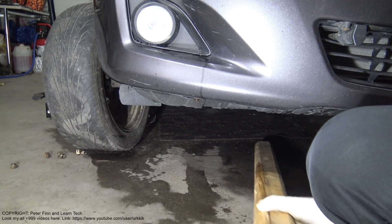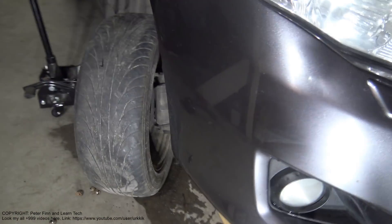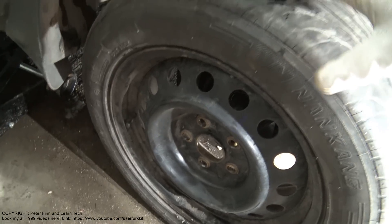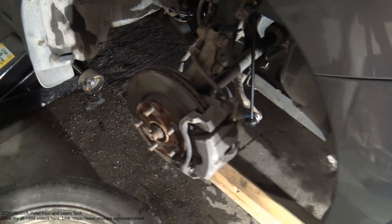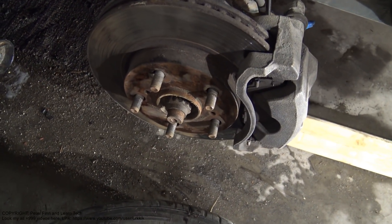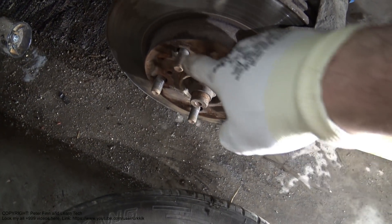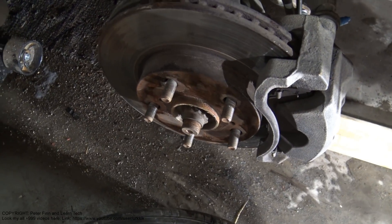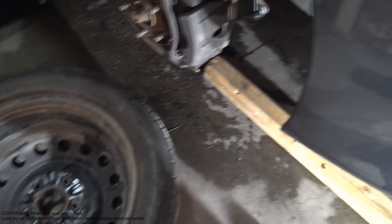Yes! Excellent — now this wheel is free. There was really a lot of corrosion there. And this is the idea — I managed to take that rusty wheel off. In that area we had so much corrosion and rust. If we insert some lubricant grease or copper paste in these areas, then we can eliminate this corrosion in the future. But now I managed to do it. There is my bat — remember, wooden blocks!